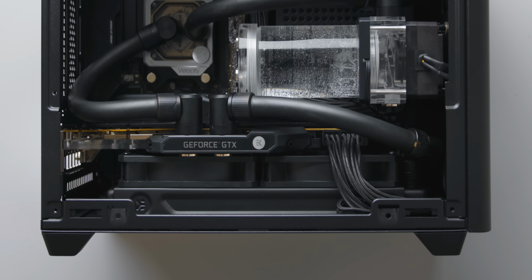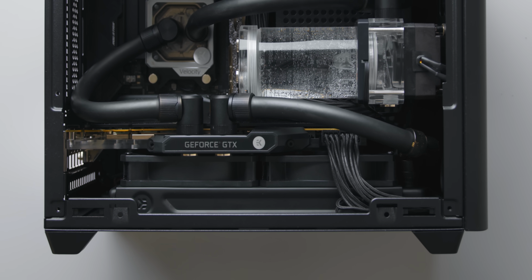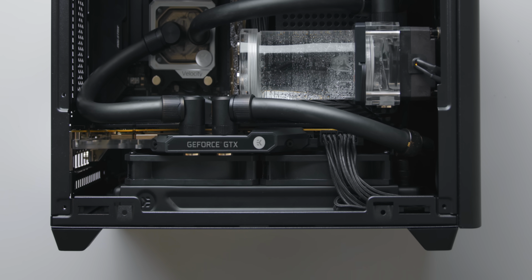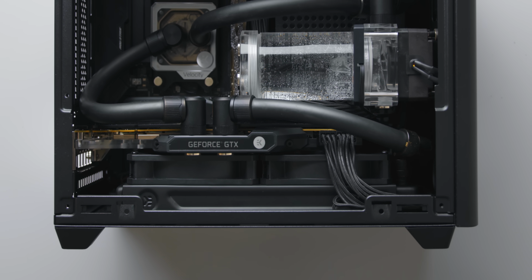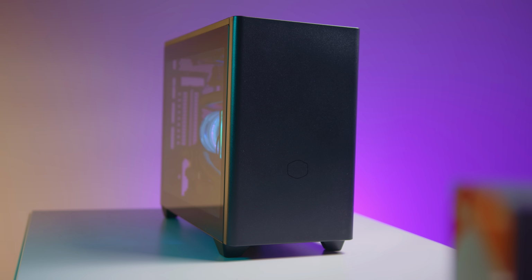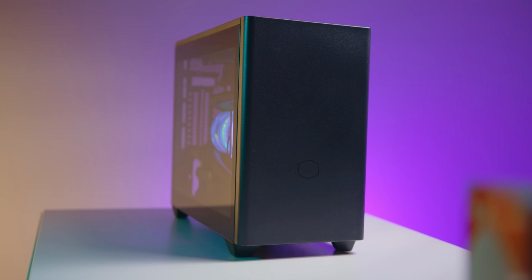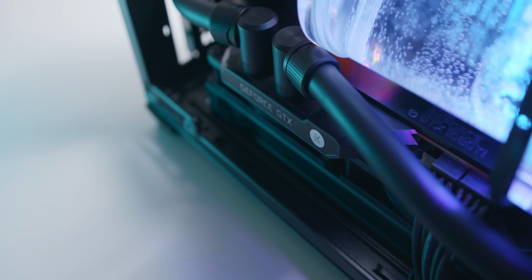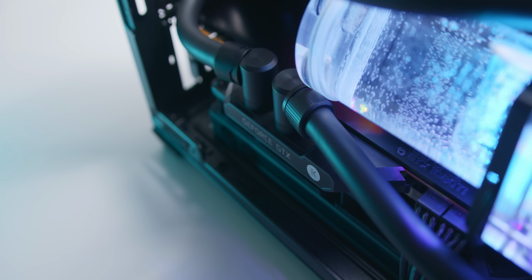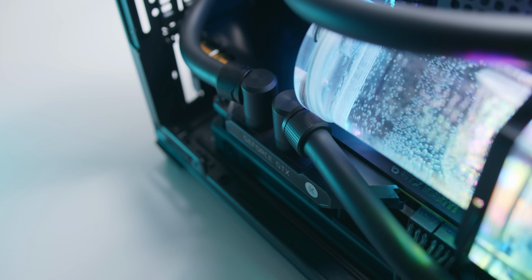Here I'm using an EK Classic 240mm SE radiator that's 27mm thick, paired with some Nidec Gentle Typhoon fans, which amounts to 52mm of thickness. So that's pulling air up into the case, and then the hot air is actively exhausted by two 120mm fans at the top. This is also the first build that I've done with EK's torque fittings, and I'll just say that I've already ordered a bunch more of these for future builds.